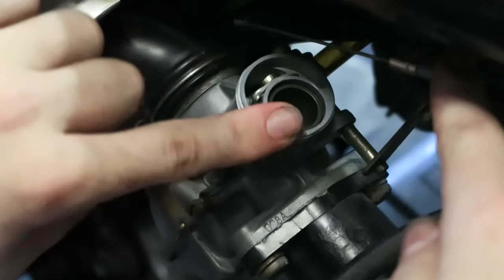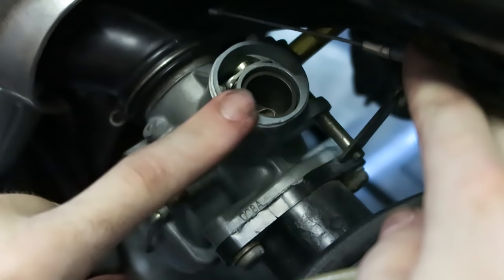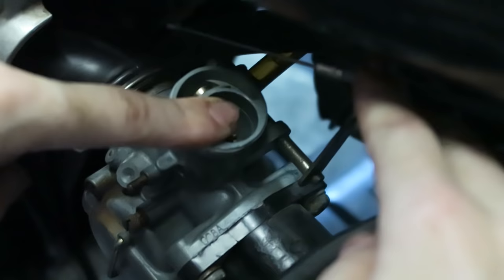So it's in the hole and you can close the carb, but this is technically all the way open. What it really needs to be is 180 degrees from there — and look at how much further down it goes to actually close the throttle. That's why it was racing and scaring the crap out of me earlier. I put it back together that way and it is okay.